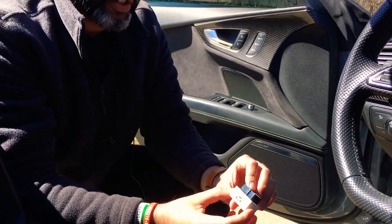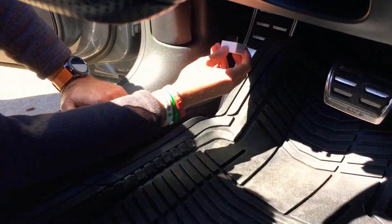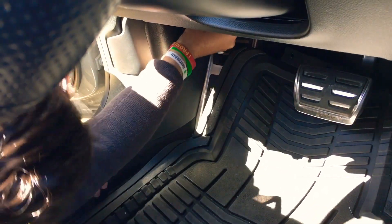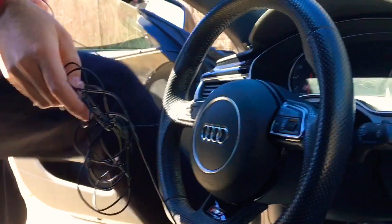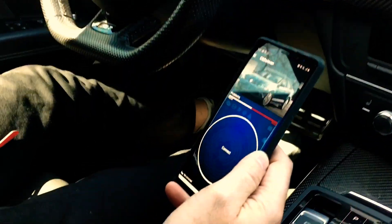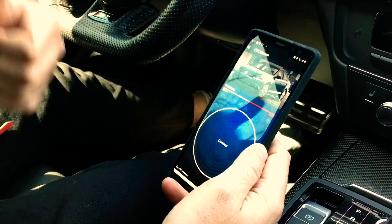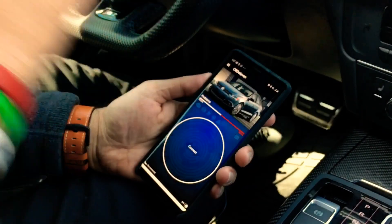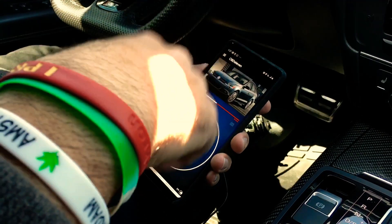Let's get started. I'm going to take this device and plug it all the way down here in the car — you'll see it's a purple OBD port. Once you plug it in, it fits perfectly. You want to set your car to ignition on but do not start the car, or put it on a trickle charger. Then you can connect — turn your Bluetooth on. On your phone, I'd recommend setting it to airplane mode if you're expecting calls, because you don't want your coding session interrupted.